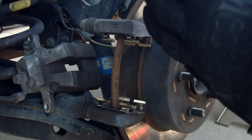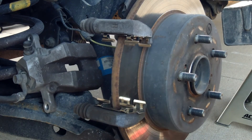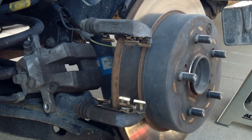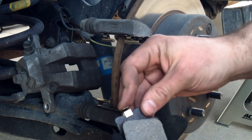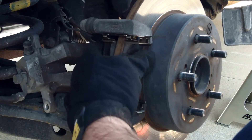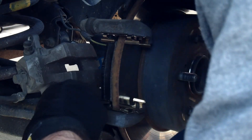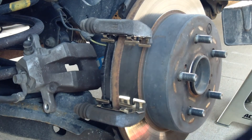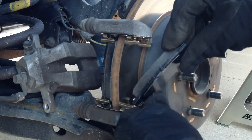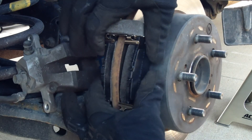Get the new brake pads here. The wear indicators — these little things come separate. I don't know how I feel about that, but you just take them and face them towards the pad. I'm going to go ahead and put the back one on. Make sure the wear indicator got in there where it's supposed to. Now I've got the front one here — make sure that wear indicator gets in there right — and then go ahead and feed it into the top and push them together.